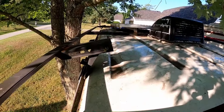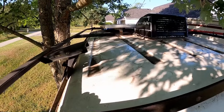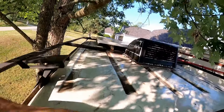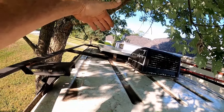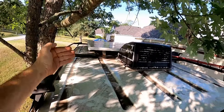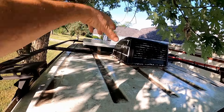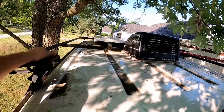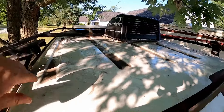Another job — it's optional, not critical — I've been wanting to upgrade the power in the van by putting another solar panel up there. I need to do some measuring. I have four 100-watt panels up there going from side to side — 400 watts of solar on the van. I thought I'd turn one panel longways this way, with the wires on one end to easily connect into the others. But I don't think we quite have the space that way.